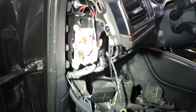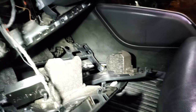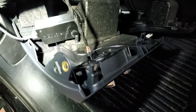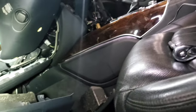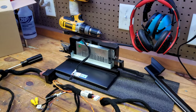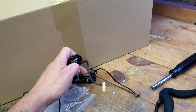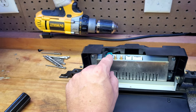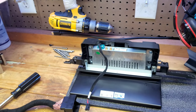We're getting close to putting things together. I would suggest pre-wiring your two antenna wires — they're a bit tricky to get on. Connect both antennas to the unit: 4G goes next to the blue plug and GPS goes next to it. It's clearly labeled on the back. Get those connected before bringing the unit over. Everything else you'll do in the car.